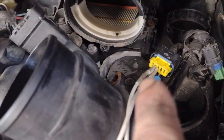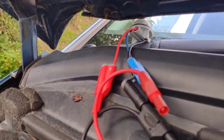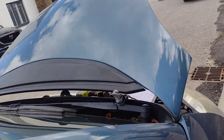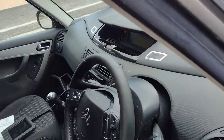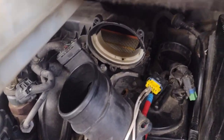I'm also checking the other two wires - those white ones are going to a light bulb I got off eBay and a couple of connectors so I can go for different brightnesses using that test kit. I noticed if I switch the ignition on, it lights dimly and then goes out. That's telling me the wiring for the motor side is okay, it's just not doing anything - it's not moving. The motor doesn't move.